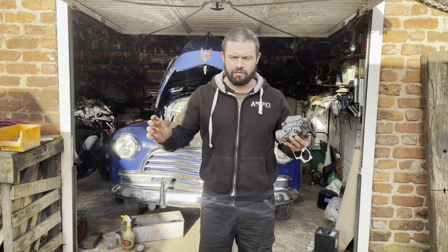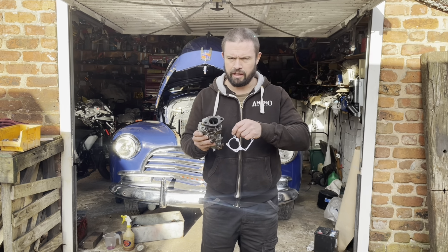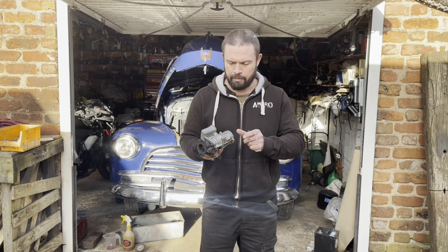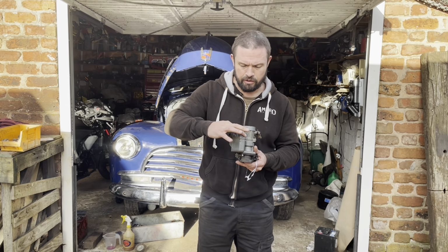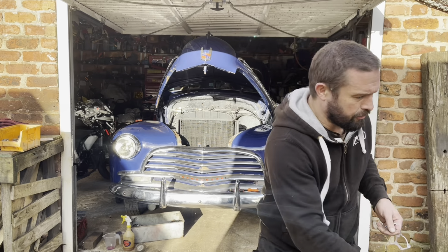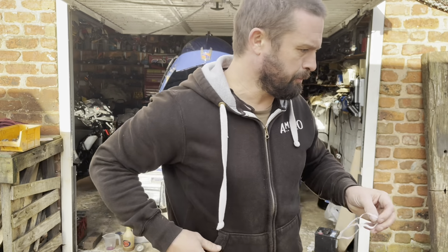Right then, it's 5 weeks later now, and I've made some gaskets for the carbs. Yeah, it's very important that you make these absolutely perfectly. So what I did was I just split the carb, had quite dirty hands, so put some thin sort of printer paper on top of where I wanted to make the gasket, and just went down the outline with my finger, which left a perfect outline of the gasket, which was that, yeah? See that? So it's a paper gasket.